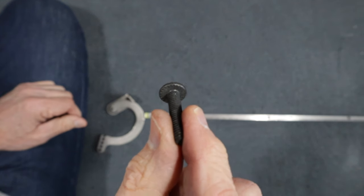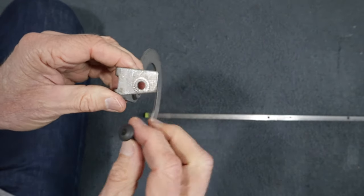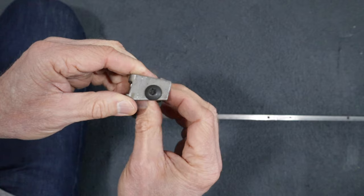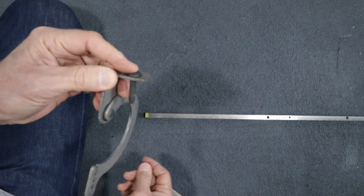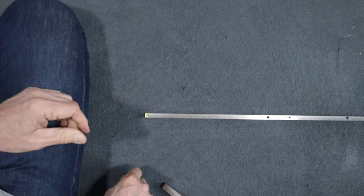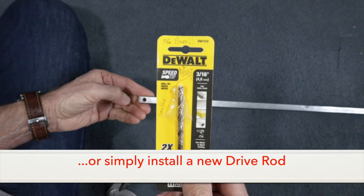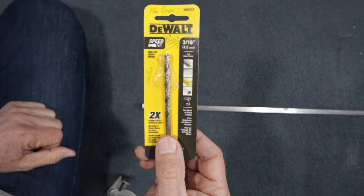On the backside of this bolt head there are little ribs, and those ribs allowed the bolt head to seat pretty firmly against the metal part. These little marks you see are actually indentations — when high torque is used installing these from the factory, these two parts can actually seize together. So try striking the sides of the flange; I had good luck with that. But worst case, if you have to drill them out, use titanium bits at 3/16ths of an inch, which is slightly smaller than the opening the fastener fits in. That way, if you drill the fastener out without enlarging the hole, you can use the same size fastener when you reassemble.